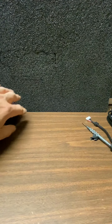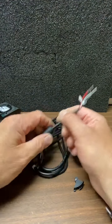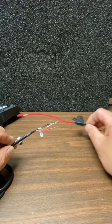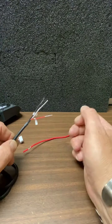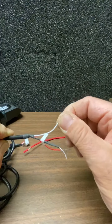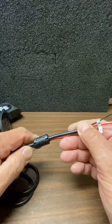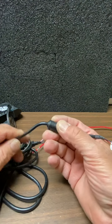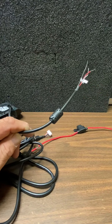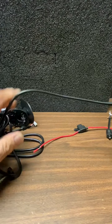So N2, N3, N2 conversion — let's get that out of the way. Here's the N3 harness. When you open it up, you might wonder how you're going to make this reach everything. You're supplied with a fuse holder and an inline fuse. Red is hot — it's labeled. White is for ignition. The ground is marked with a little negative tag. There's a ferrite coil here which is supposed to reduce interference — they may have done this for compliance or engineering reasons. What we do is simply cut it off. Now you have as much wire as you need.